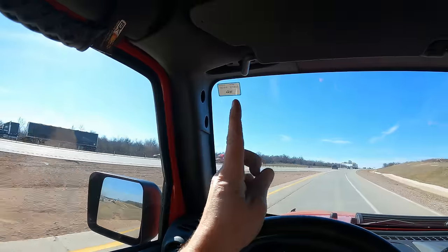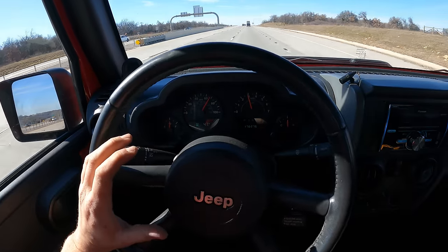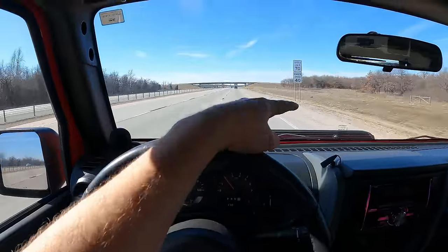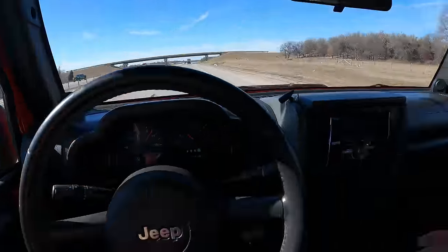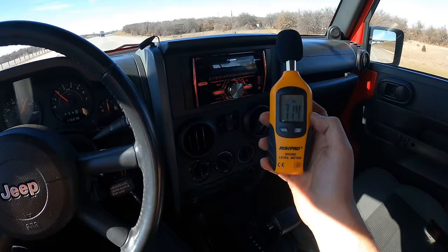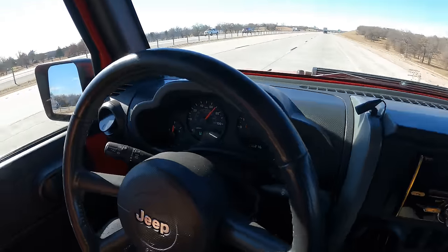I've been driving for about 20 minutes, and it is a night and day difference. We can't get it any quieter right now because we have a little roof leak — some seal up there is leaking a little bit of air. But the floor is completely vibration-proof. There is almost no road noise coming from underneath the Jeep, and that's of course because we have road tires on right now. The only thing I hear is a little bit of a light bar whistle and that small air escape. Breaking out the sound meter at 75 miles an hour: a consistent 71 decibels. At a certain point we can only bring it down so many decibels, however if this was a modified Jeep I think we would see a drastic difference — and moving forward, once we start modifying it, we're going to keep a lot of this sound deadening throughout the stages of the build.